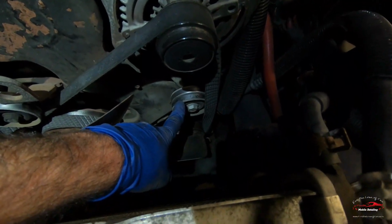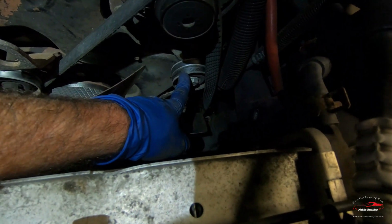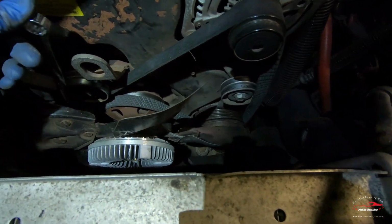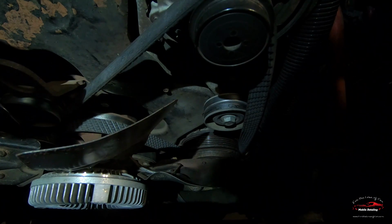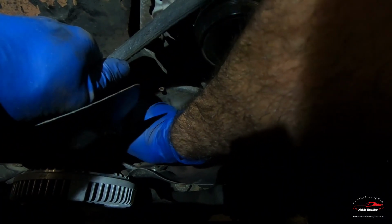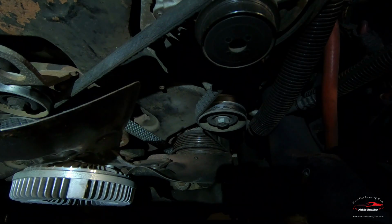So this pulley here is basically the one that I leave till the very end to put on. It's always easier to stretch the belt over a smooth pulley. So now I can just push the wrench over and pop it on. There's pretty much no way for me to hold the camera while I do this. Another nice thing about this long wrench too. Push that over. Get it on. Make sure the belt's on all the other pulleys. And she's good. It's on.